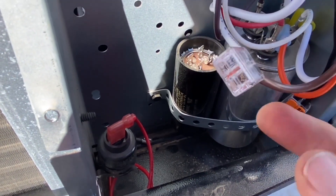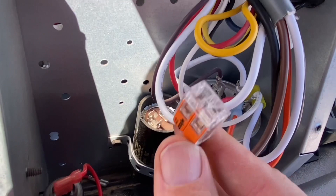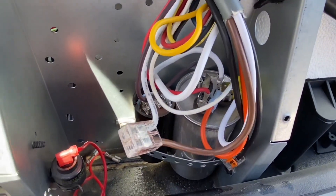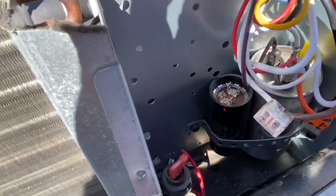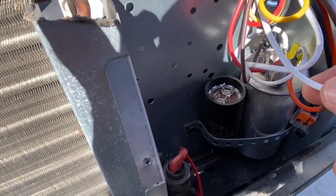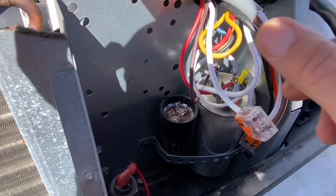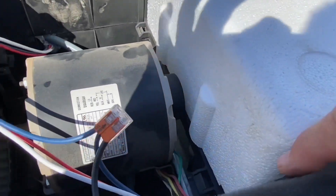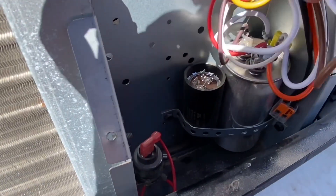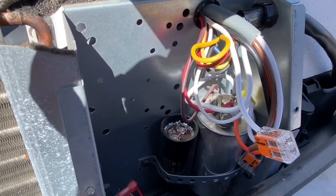The brown wire did have a connector on it — you just cut it off and wire it together. I used Wago connectors; these things are pretty cool, I'd actually never used them before but they work really well. The next step was to find the white wire that runs to the compressor. We had to trace it back down this wire here — that's where you hook to the brown wire. You just follow it back here, and that's the one that goes over to the compressor. Make sure you get the right white wire because there are two that come through from the other side, but it's easy to trace — just wiggle it and you'll find it.